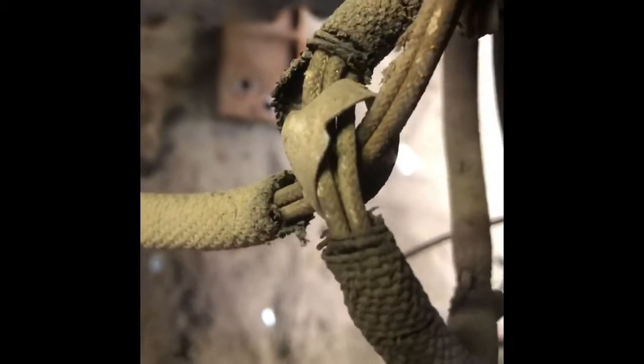So there's the front of the frame. I'll weld a piece of angle onto the front and it'll angle out to the side of that grill shell, which is very very thick aluminum. I'll drill into the side of that grill shell — basically that grill shell will bolt to the piece of angle that I weld to the front of the frame.